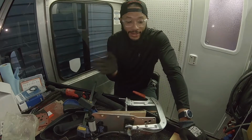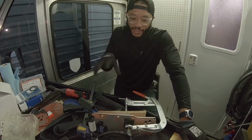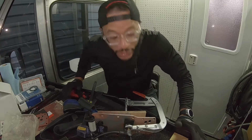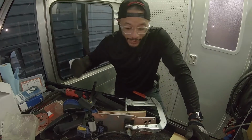And when I get done, if everything's still sitting at 72, I'm cool with that. What you could do also is just spray this down with water just to see if you see anything, but I'm gonna just go by the pressure. I don't have too much of the surface area blocked on the top and the bottom. So if it holds the pressure, I'm gonna call that good.